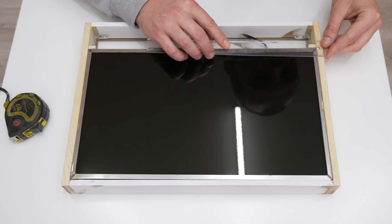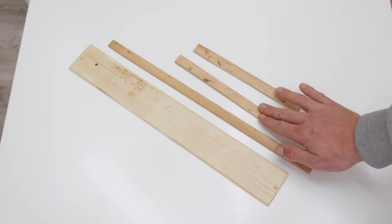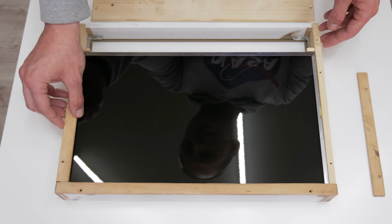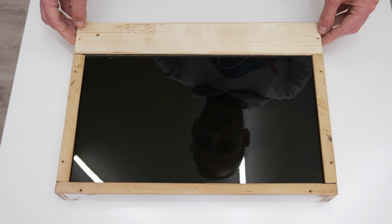Well, after I finish with the back side, I move on to the last thing, and that is making the display bezels. The display bezels are made from wood also. Three of them are thinner for the top side, left side and right side, and one is larger, and that is for the bottom side. Also in the bezel, I made holes where later we will place the screws.